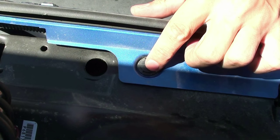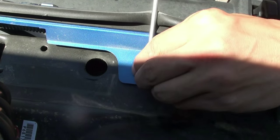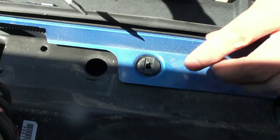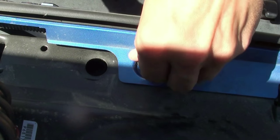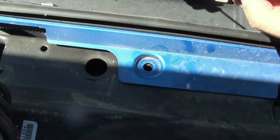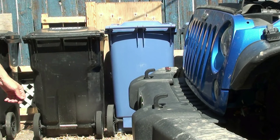Next, you've got to take out these clips — there are six of them on top of the grill. It's a two-piece thing: there's a center plug you take your flathead screwdriver, wedge it in, pull up the centerpiece, and then very carefully take the outer piece out. Be careful not to scratch your paint — it might be inevitable, I got a few scratches on mine. Take out all six and you're good to go.